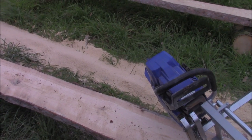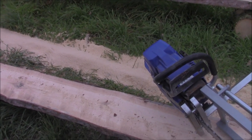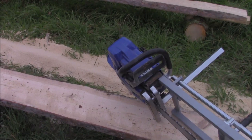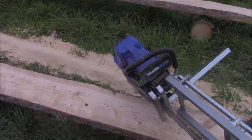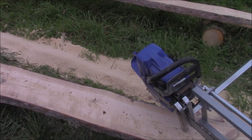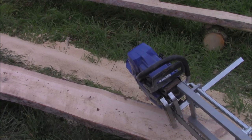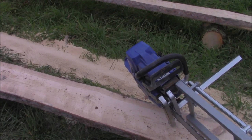And so those are two messages that you don't really hear much about when people are talking about their cool, hot, modded saw and machining and all that. One is, have they thought about that balance between how much heat's generated as a result of what they've done versus the stock cooling system? Have they exceeded the ability of the stock cooling system and fins to rid the saw of excess heat, based on the efficiency of the burn, how much more gas and air is being burned now because of the modifications, you know what I'm saying?